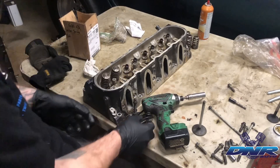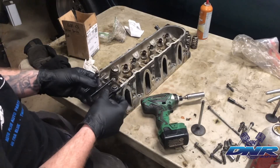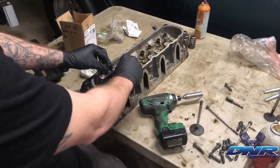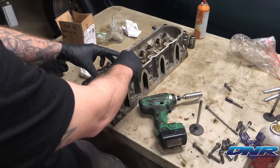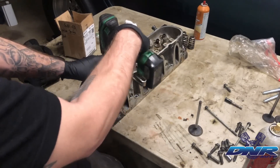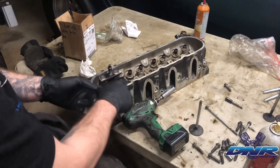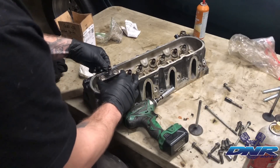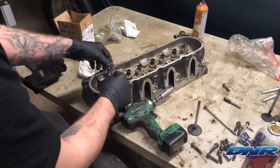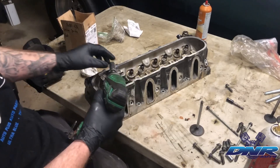So I'm going to jump right into it. Now, anybody doing this for the first time — general rule of thumb — you probably shouldn't be doing this with an impact gun. But these are junk heads that I don't care about and I've done this a few times, so I'm just going to use the impact gun for the purpose of making this video. You've got the tool that bolts down with a spacer in between into where the rockers went. Get it lined up as best you can. It's important to try to get it centered because that'll help the retainers come out easier and go back in easier.